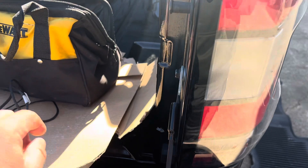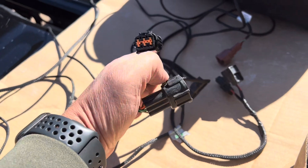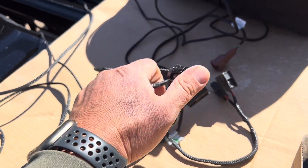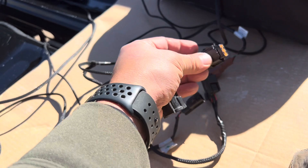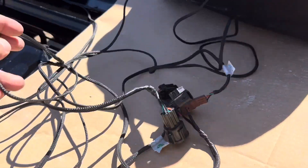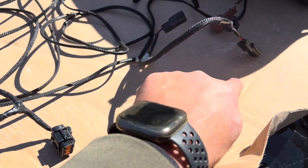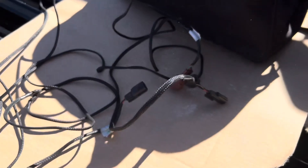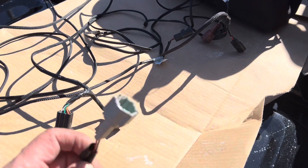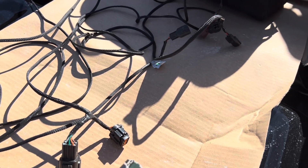Once these two connect, it runs right back to the stoplight. We have to take off the right stoplight, and it's already set up — it's split, so it's pretty plug and play. You plug one end to the light and then the other one to the plug itself where the power is coming from. Then in return it sends power right back to the roll bar plug. So it basically comes from the front, hooks up to the taillight, and then runs right back as a return to the bar itself.